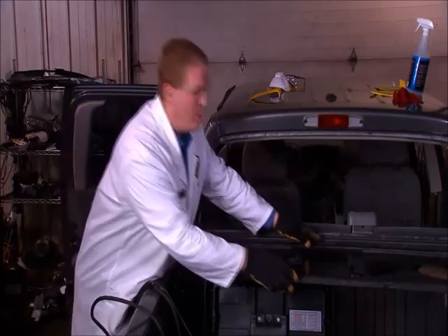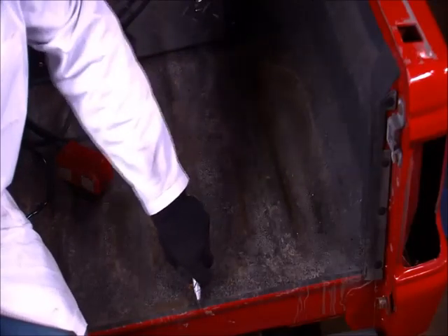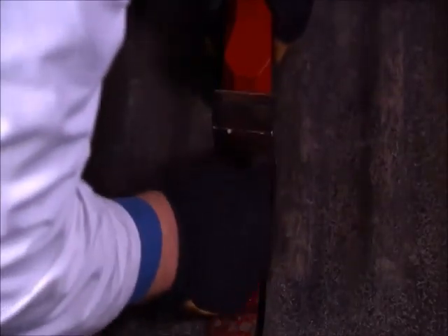We got this window out in about nine minutes. Spray-on bed liners can be a bear to remove by conventional methods. With a glass blaster attachment, we can reduce labor time up to 88%. It is easiest if we score the liner before we heat. Place the attachment only on the liner, as the liner protects the attachment from the radiant heat created. Using a metal scraper, follow the area heated.